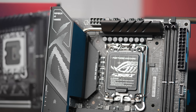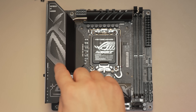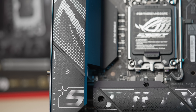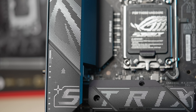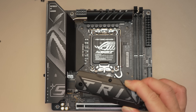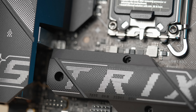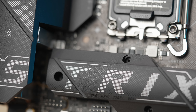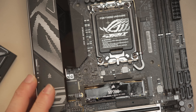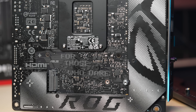This board offers good compatibility for low-profile air coolers. The rear IO heat sink does have a more extended slope downwards compared to the B850i, but I mocked up a few low-profile coolers and they mostly seemed fine. Combined with the low M.2 heat sink, most users will find this is a good board for top-down air cooler compatibility. At the bottom of the board we have the M.2 heat sink, independent of the power delivery cooling. The front M.2 slot is specced for a Gen 5 drive with the latest Q-Latch, and on the back there's a slot for a Gen 4 drive.